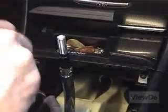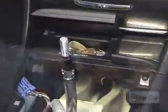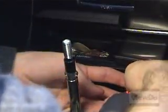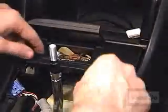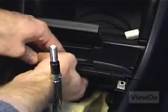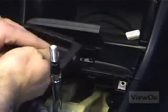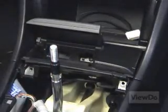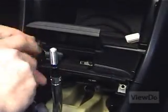With the Phillips head screwdriver, remove the first two screws holding the coin tray and power socket in place. Be sure to keep track of which screws go where for reassembly. Remove the tray liner from the tray. There are two clips holding the plastic coin tray in place. Place your hands underneath the coin tray and push up and toward the back of the car to release them. Remove the now exposed last two screws holding the coin tray in place.